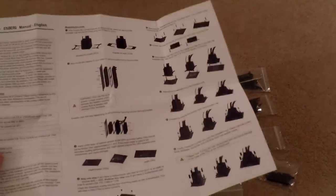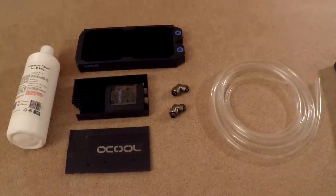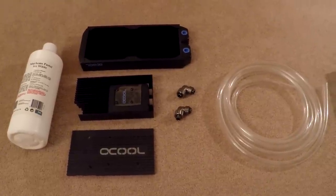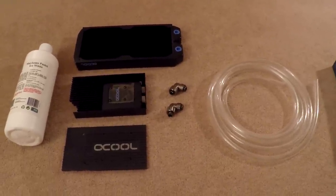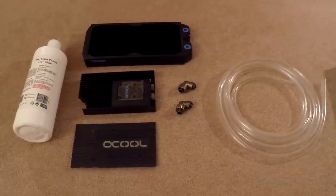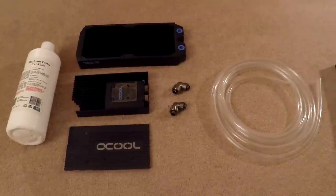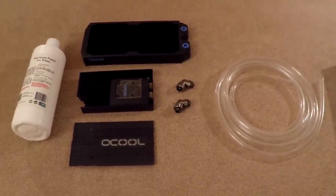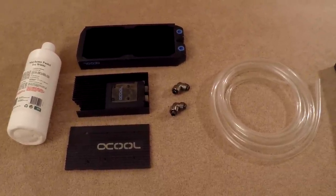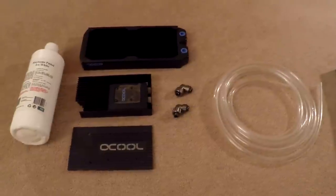What I'll do first is take the GPU heatsink off and put the GPU water block on. I need to figure out where I'm going to place everything on the existing mounting board — I'm hoping everything can fit on there. The mounting board is made out of HDPE, high density polyethylene. If I need to I can cut a bigger piece. So I'll get all the components together, unplug everything, start arranging it, and show you what I've done.